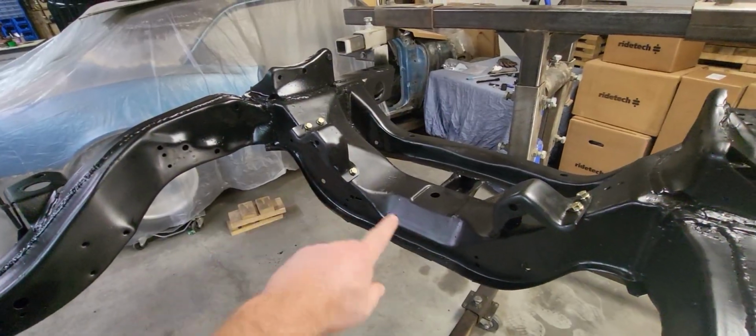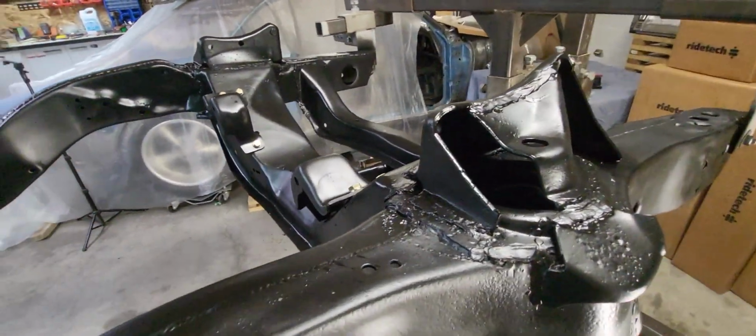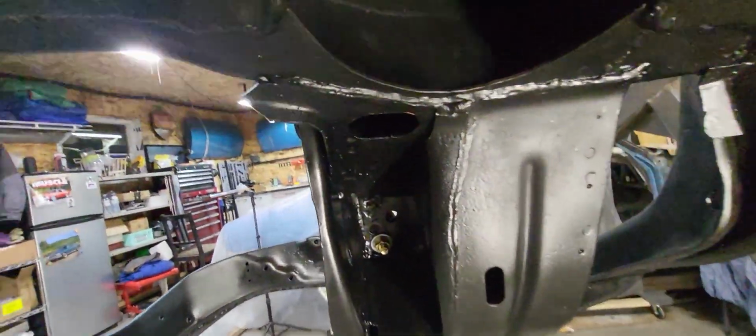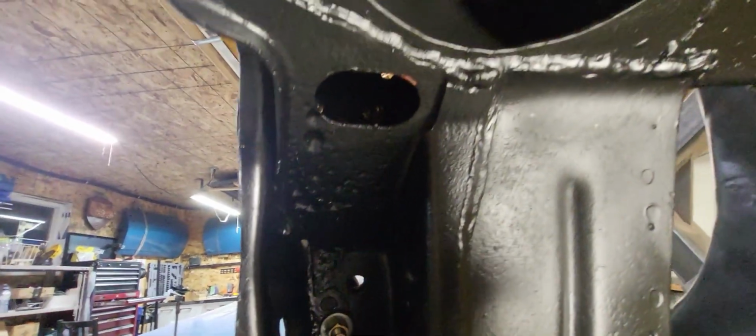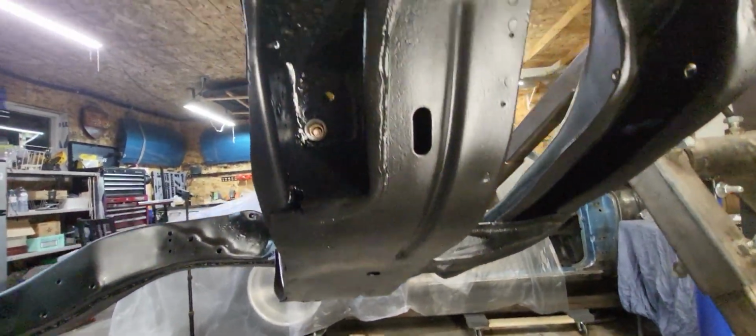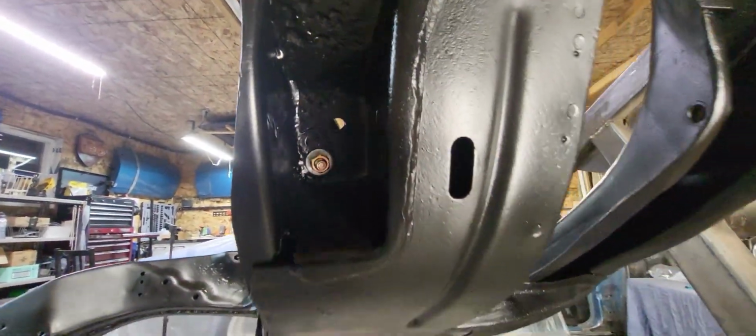Okay, the motor mounts are bolted to the subframe there and there. It was good it was on the rotisserie so that I could kind of tip it up, because you have to get in this little hole here to get the nuts on the back side of these guys. There's one there and one over there. And that's kind of hard to do if it's up on its side. I lost like 4 nuts inside of this thing, but luckily they roll around and fall out.